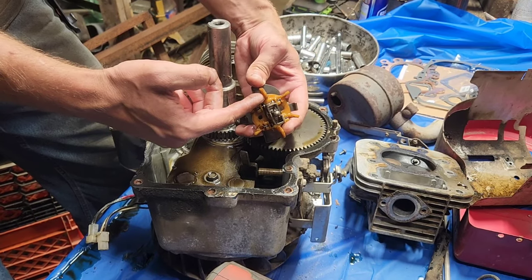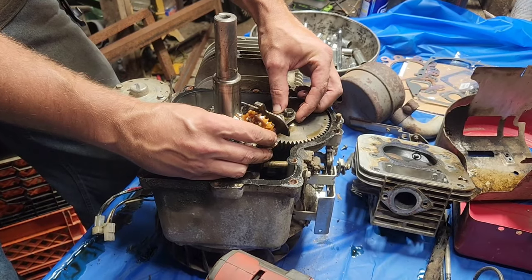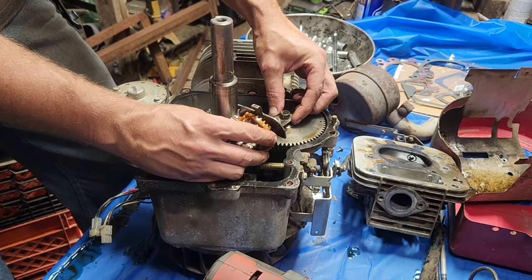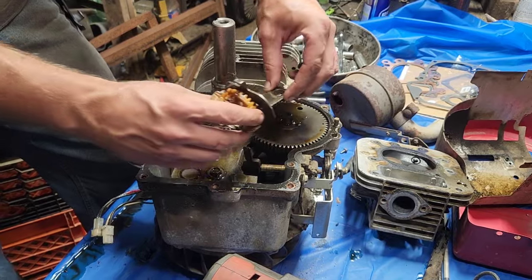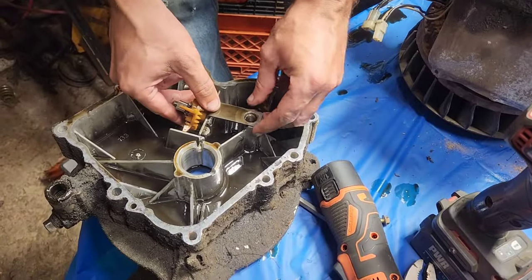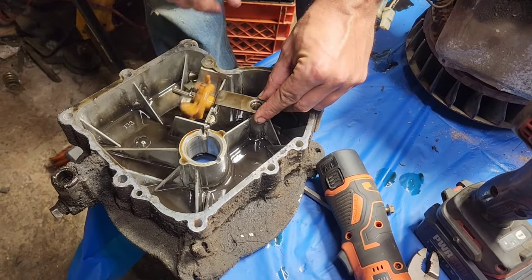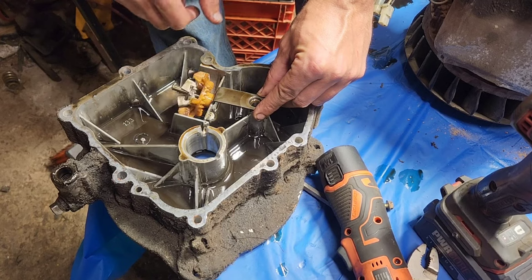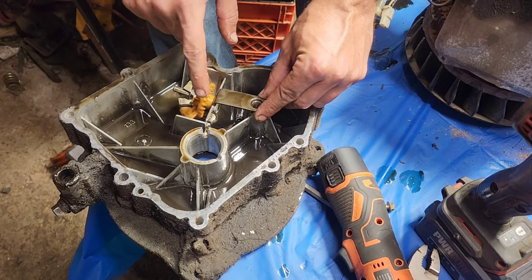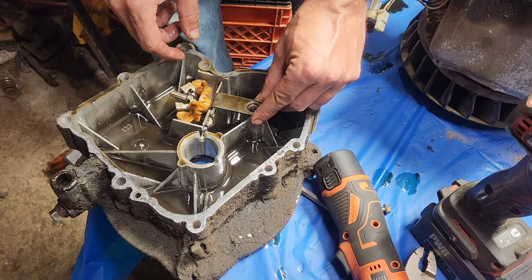You can't do that on one of these Briggs because the governor is also part of your splash lube system. This sits like this — which is currently the bottom of the engine flipped up. If we come over here into the bottom of the engine and flip this around, this is where it sits splashing oil everywhere in the engine. This piece you have to maintain, otherwise bad things will happen.